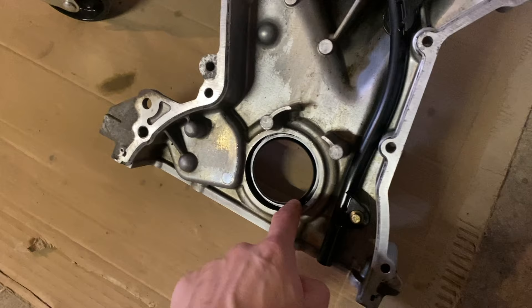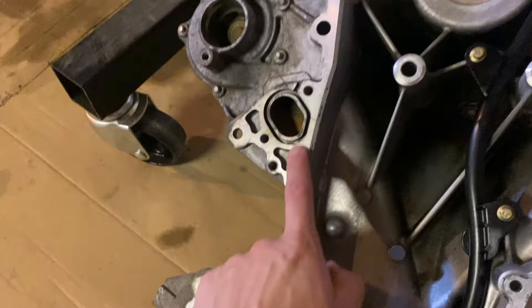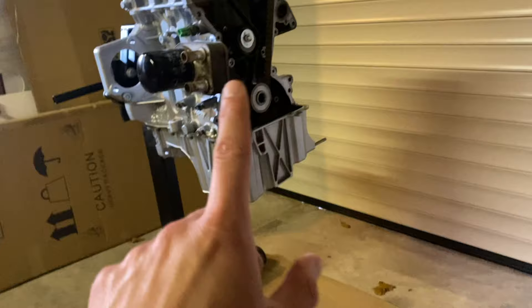It's a new day and it's time to carry on — nearly time to install the timing cover. I've already cleaned all the mating surfaces, but I need to knock out this old crankshaft seal and reinstall the new one once the cover is fitted, and also put a little seal in here before the cover goes on. This next bit is quite critical — if I get any leaks after sealing the timing cover and the sump, then fit the engine back in the car, fill it with oil, get it running and something leaks, I'd have to take it all out and do everything again, which would also mean a new crank pulley bolt each time. So I'm going to take my time, make sure I've got everything I need, and get this right first time.